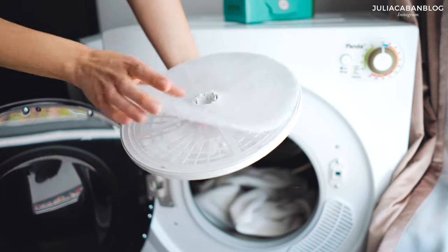Since I got it, I haven't had any issues. I make sure to clean the filters regularly. There's one filter on this side, one filter here that should also be cleaned regularly and replaced from time to time, and one filter inside. I usually try to clean it twice a week — sometimes I forget and do it once a week. It's very important to keep your dryer filter lint-free, because if you let lint build up over a month or longer, it may cause the machine to overheat and break.